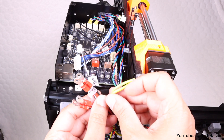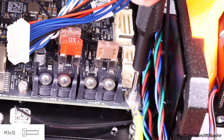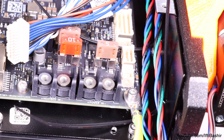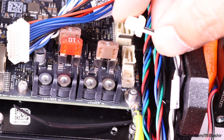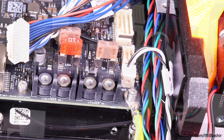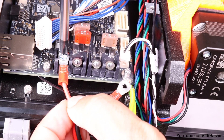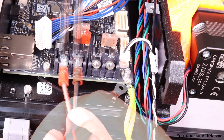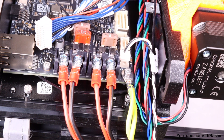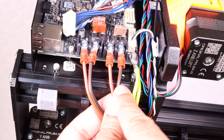Here we need to start connecting into the board. Begin by attaching the PE cable to the lower right screw hole in the X-Buddy box using a single M3x6 screw, complete with an M3 washer in between. Tighten the screw firmly while making sure to guide the cable so it does not interfere with the threaded hole under the electronics board. Connect the power panic cable next to the white connector on the bottom of the X-Buddy board, just above the previously installed cable. Before moving on to the four power cables — these have circular connectors so the screw will pass through completely. Using the supplied power terminal screws, start with red, then black, then red, then the final black. Make sure all terminal screws are firmly tight. As with the power supply, double check to ensure cables are installed in this orientation, as incorrect wiring can cause major damage to the printer.